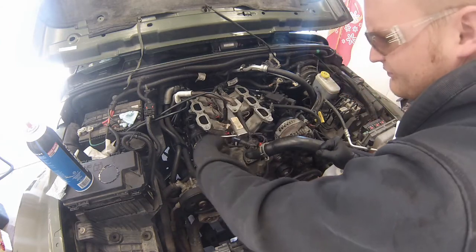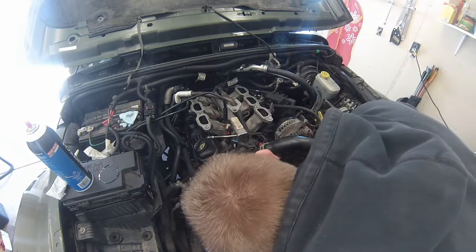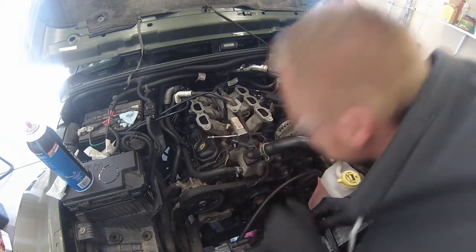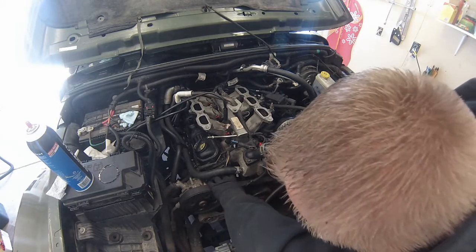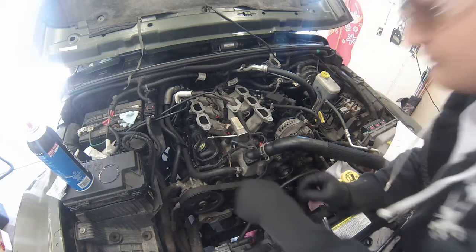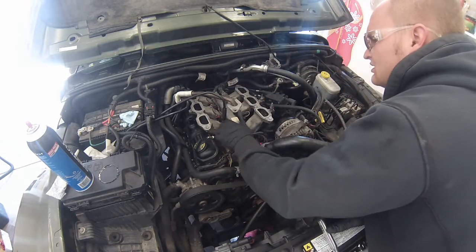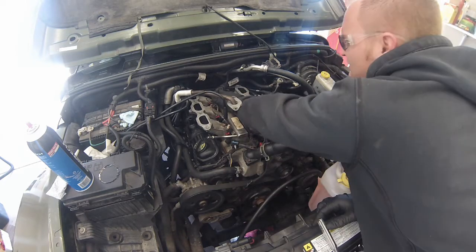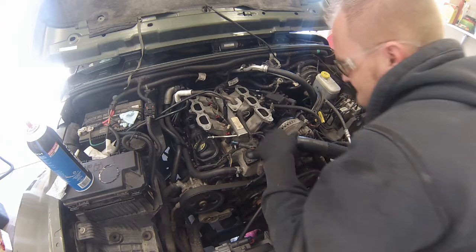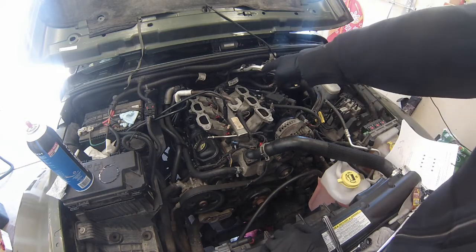We have a couple more. This guy down here — I believe that might be a camshaft position sensor, I'm not even sure on that one. Make sure the locking tab is in, wiggle it around a little bit. This one goes to the throttle or the butterfly valve. Make sure all that is good, laying flat. And I'm going to take a zip tie and zip tie that together. Everything looks good electrical wise. Next up, I'll zip tie that down, and we'll go ahead and get ready to put the upper intake on.